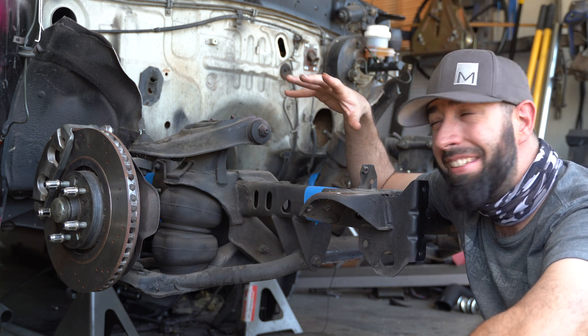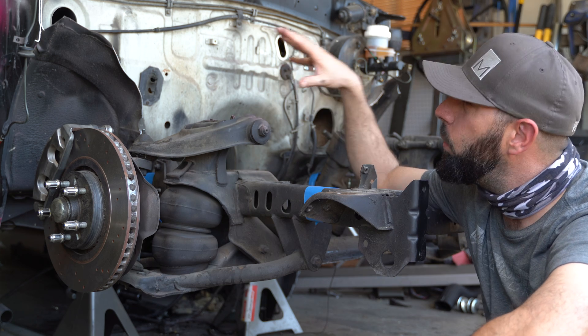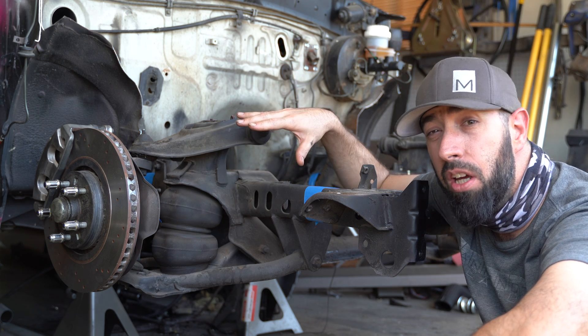For simplicity, imagine a static height vehicle and then lower the body around the suspension without even touching the springs. Now before you decide to just go Z your frame — which I highly recommend — I should mention there's going to be a lot more involved than what you'll see here today. The steering components are going to go along for the ride when you relocate your suspension, which means your steering shaft, column mounts, or maybe even your dash may need to be modified to account for the movement in your steering column.